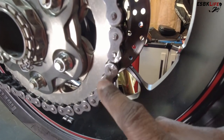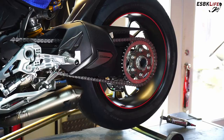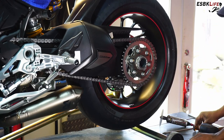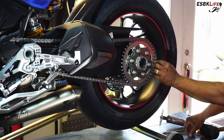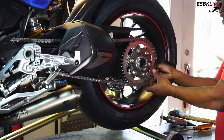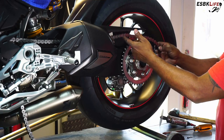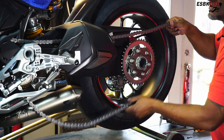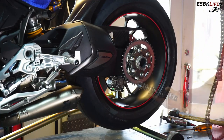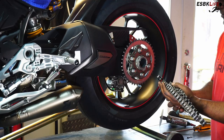You can see here that we just knocked the faces off our chain link. Now we're just going to grab a screwdriver, remove the O-rings if they don't drop off. Now the chain will separate from the back — we can pull out that pin along with the O-rings, and then the chain will disconnect from the top and the bottom. If you have it in neutral, you can then just pull the chain out.